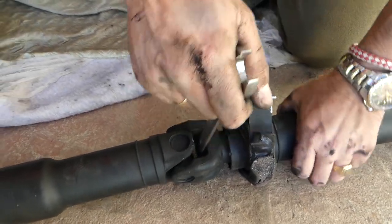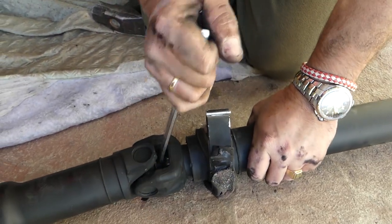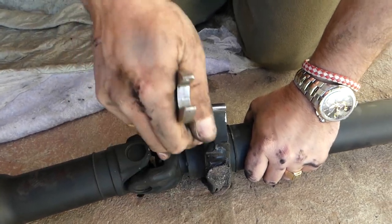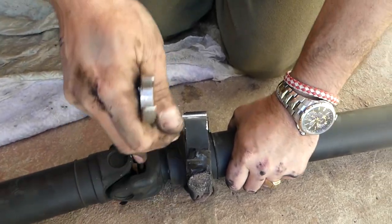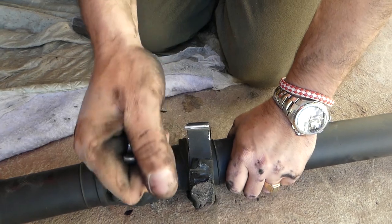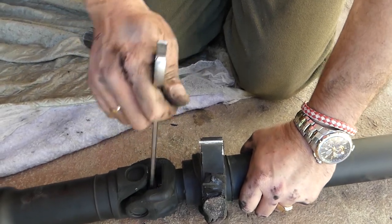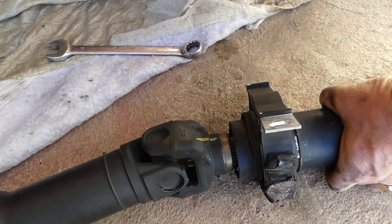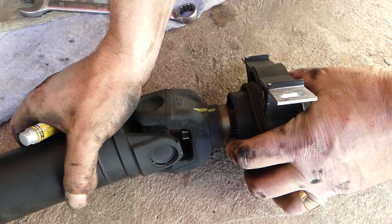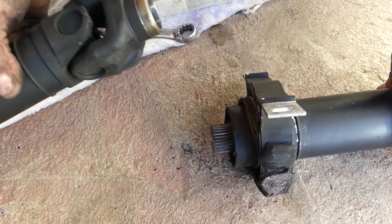With 18mm now we're going to remove that bolt so the two pieces should come apart and we can replace the bearing. You can see there's some play in the pieces. Make sure you get this one tight — maybe use thread lock. We're learning from each other, any suggestions let us know. Everything is marked. We'll apply a little more on the inside — we don't want to risk it getting out of balance. You can see the weights on it. It came out.